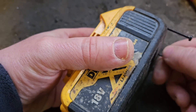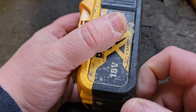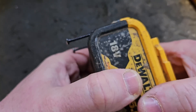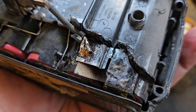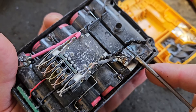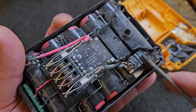Because if this happened to your battery, you could moan about the quality of DeWalt and say this failure is quite common and complain that it reflects badly on DeWalt. But if this happened to your battery, you see this broken connection that's burnt out here — that is effectively the weakest link in your battery, and it's the weakest link for a reason. That's a fuse.